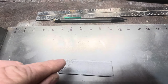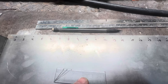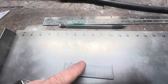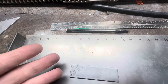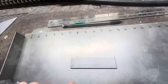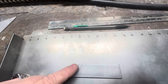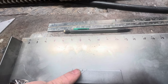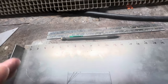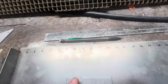So if you take height and measure distance on here, then what you get is from here to here is 1 inch. From here to here is 1 inch. If you measure it back to the corner, that gives you a perfect 45, okay? We don't want a perfect 45. So if you measure half of that, which would be what this first line is, so 1 inch back a half inch gives you a 22. Well, that's not enough tilt. So we went with 5/8. So an eighth in between.